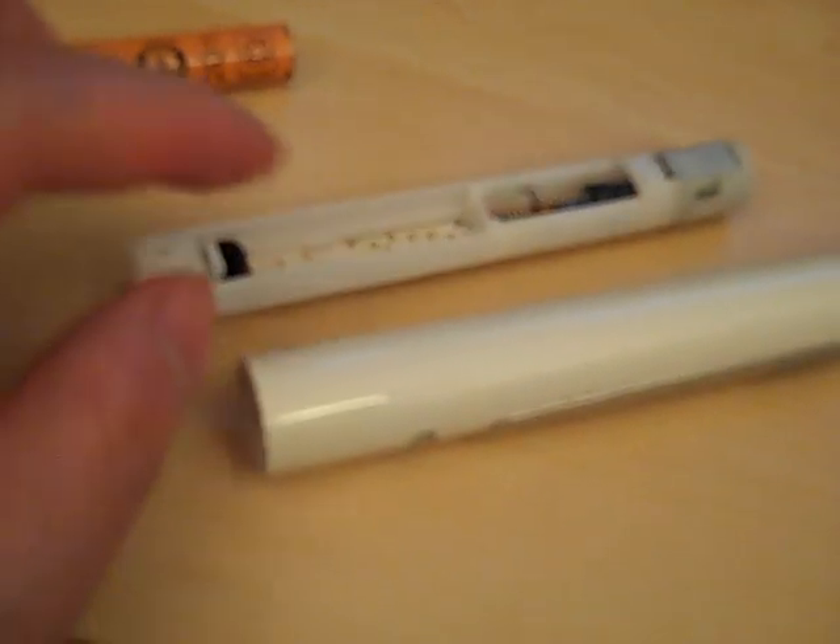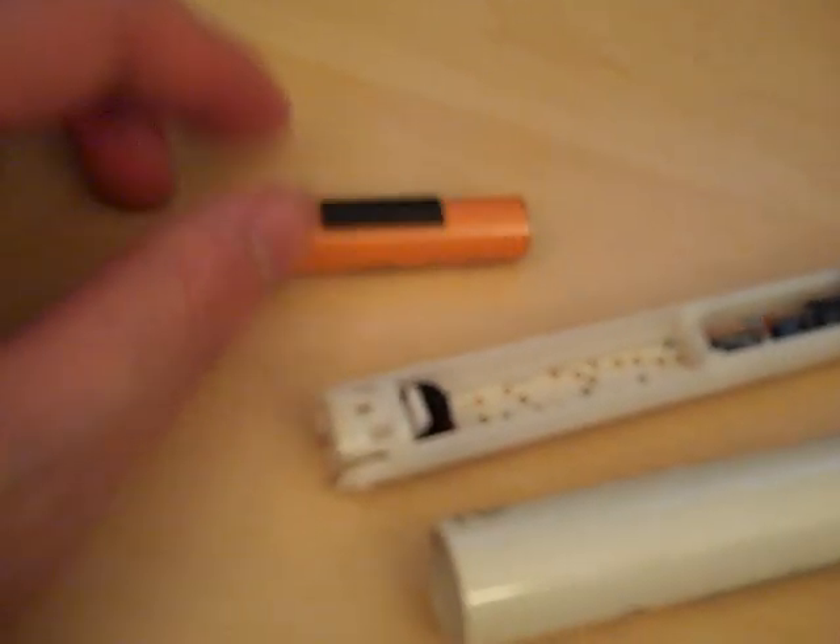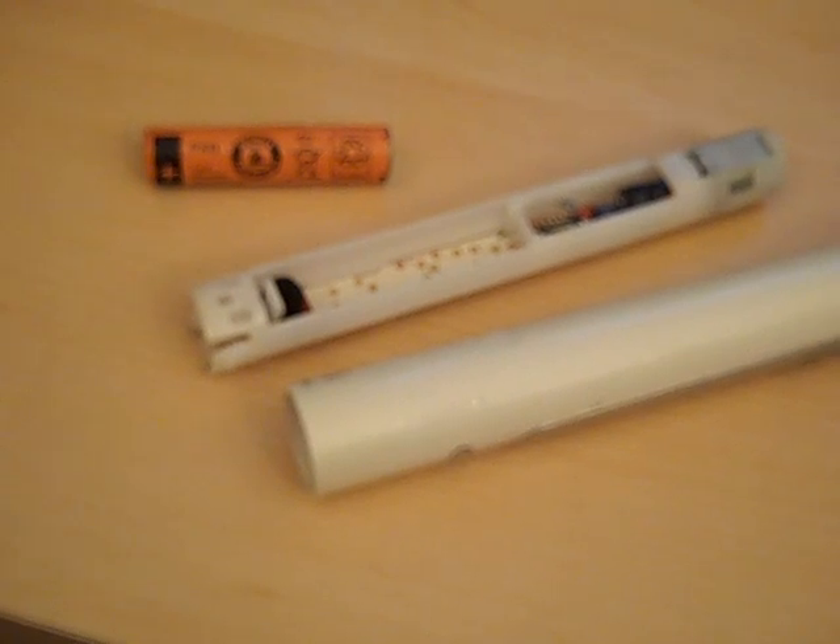Now, if you actually put a AAA battery in, it will work — it will vibrate. But it was just too much voltage for it to handle. Technically, if you want to fix this, you could just plug this into an LED and drain the charge out of it until it's about 1.2 volts, and then you can start using it again. But every time you overcharge it — like if you leave the toothbrush on the charger overnight — you might run into the same problem again and have to keep doing it over and over.